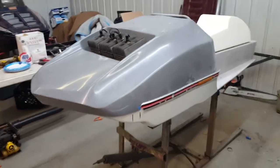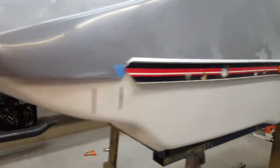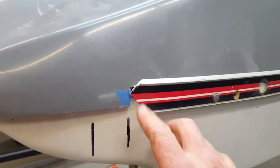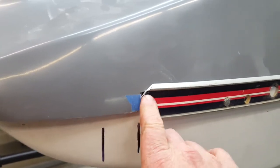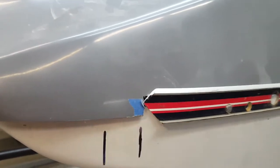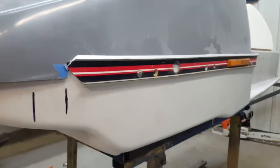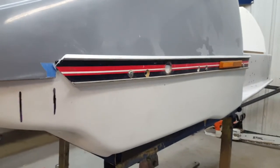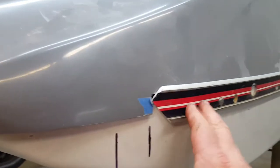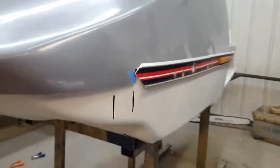I got the hood cut down here. Like I told you last time, I was going to put masking tape on there for my cut lines, and that's what I did. I ran three-quarter inch tape around the belly pan and around the hood, then used a cutoff wheel. I ended up taking about seven-eighths of an inch off the hood and off the belly pan. These side bumpers are off a TX — '76, '79, '80 — cut down at the corner before it comes around the front. They work really good for holding these hoods in place on these PDC clones.